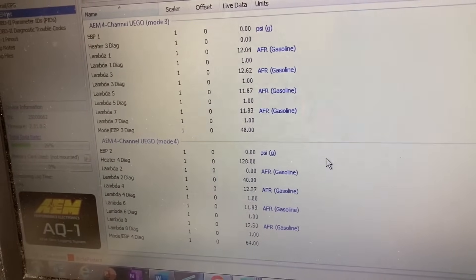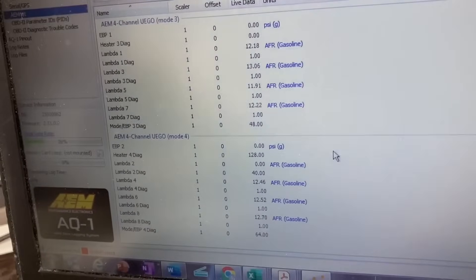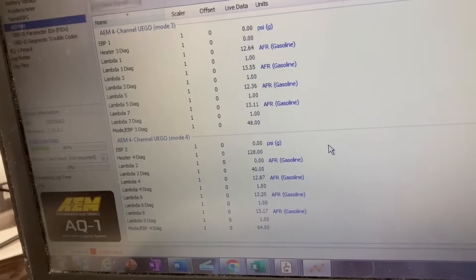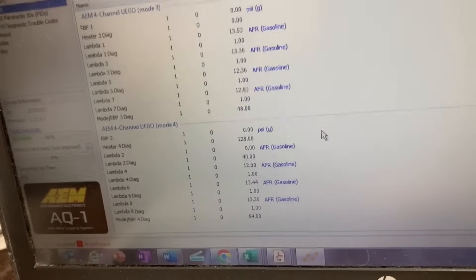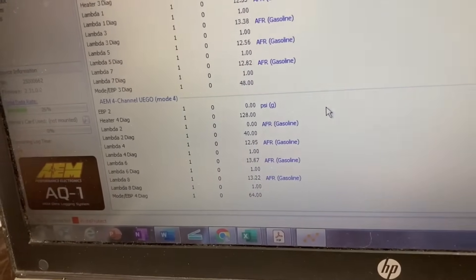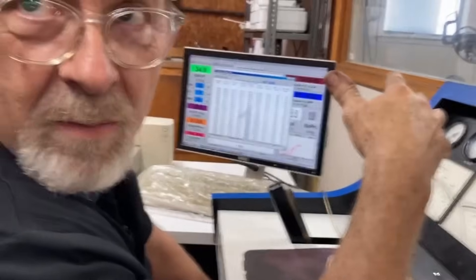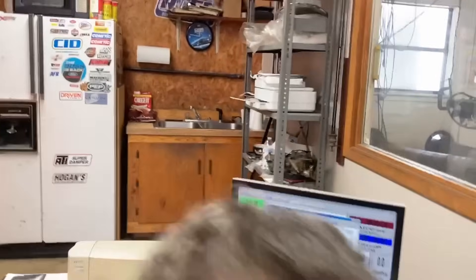The one I watched was 11.6. It looked like there was more variation between runs — I saw one up here dancing in the high 13s, and one down here dancing on 11s. It may be that the carburetor likes that. I like it from here. Do we jet down or not? I think you run it flat on the manifold without a spacer. I don't think there's any need — it was happy where it was.